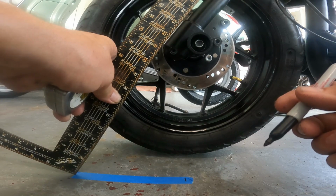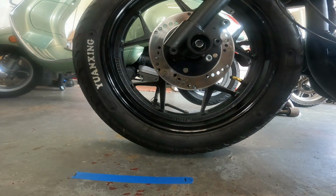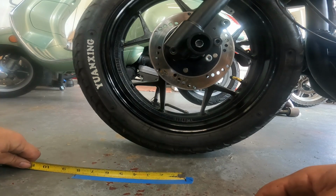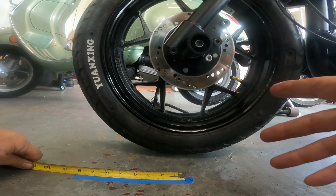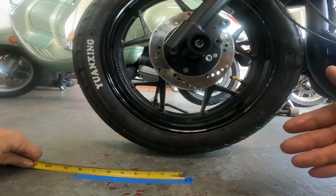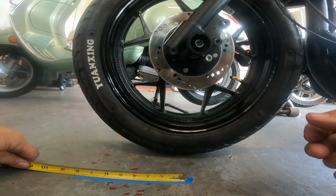And this is race sag, which is 0 on this bike because the suspension's so stiff to try to keep it from compressing. And there, and the way we ride it, you're talking about an 8-inch trail. So that's one advantage the NCY forks have over it. They're a shorter distance, so it gives you, when you take into account for the rake and everything, the shorter distance brings the front of the bike down. It actually decreases the rake because the bike's leaning forward, and that gives you a shorter trail.